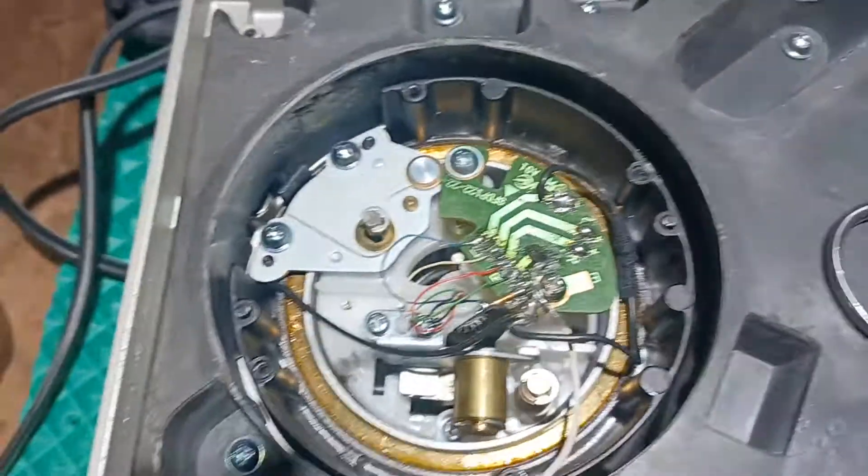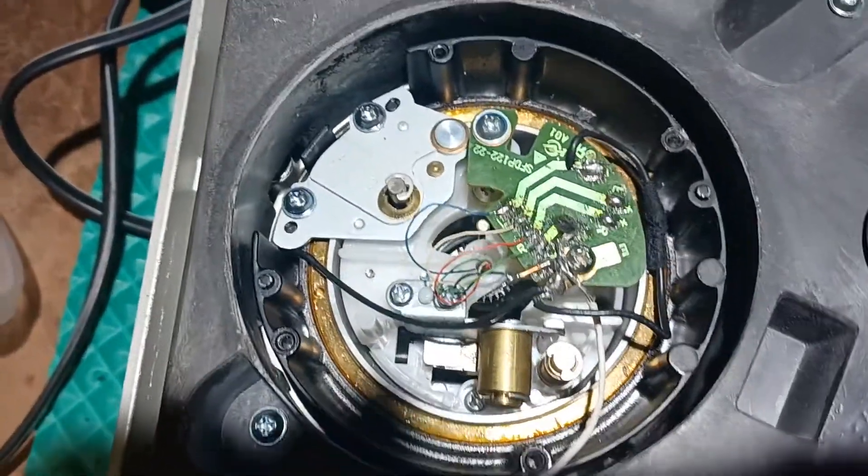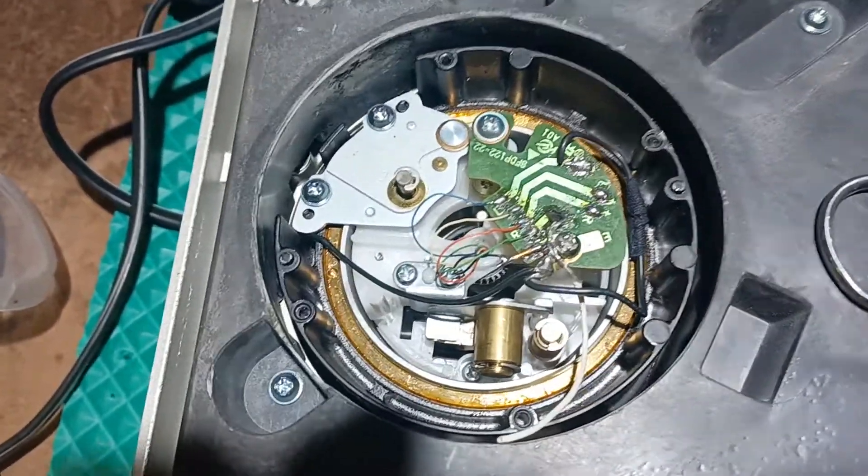So I had to take the whole tone arm off and all of this contraption — there are videos on the internet that will tell you how to do this. I want to point out what happened: those wires we were looking at on that little board, and this gold thing here on the gold version of the 1200, that's right below this. Looking at the underside, whoever had serviced this before had run those wires up through the same hole as the actual axis of the tone arm, so the thing was crimping blue and red against the case of the turntable and shorting. That was the issue.